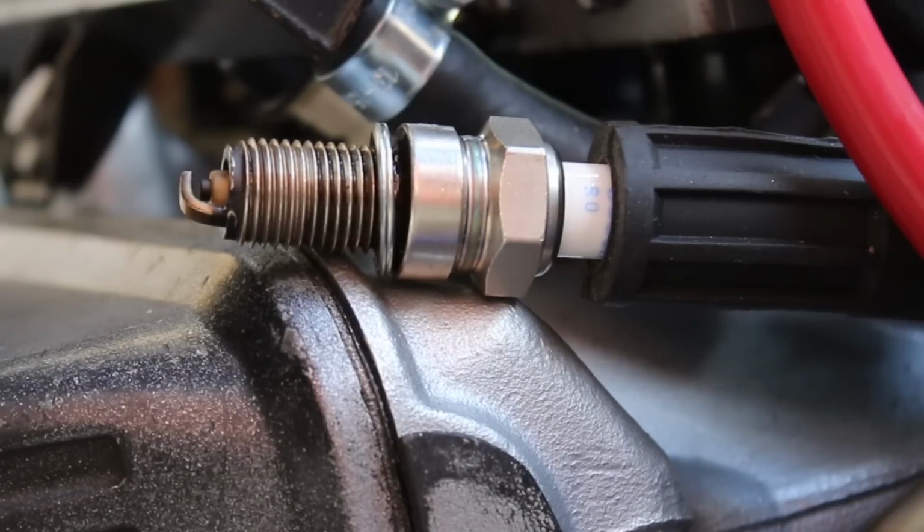Now sparks fly when you do that. It's dangerous around gas, but I cranked the starter anyway. All four of them rhythmically shot healthy mists of gasoline all over the cement. Fuel injection is working. Spark. One by one, I removed the spark plugs from the head and rested each body onto the valve cover to ground them out. All four gave off a healthy blue spark.